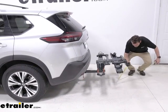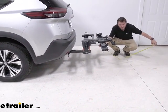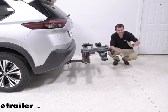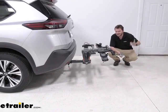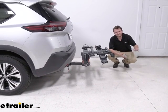The last measurement we're going to talk about is ground clearance, and by taking a look at the lowest point, we can see that we're sitting 20 inches off the ground, which means that I'm not really too worried about making any ground contact by going up any sharp inclines or parking in any driveways. Because of that shank rise that we have, that's pretty safe.